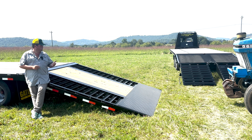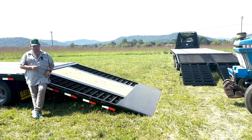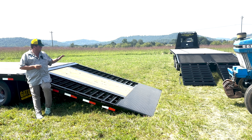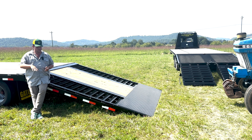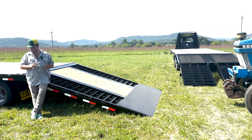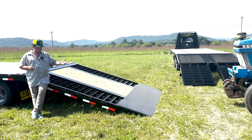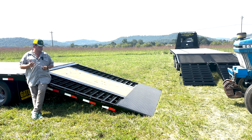Thank you for watching this video. We've shown you side by side what it's like to load on these two trailers. I load on these things all the time, and as much as I have, I still can't perfectly articulate how much more comfortable it is to load on a hydraulic dovetail. You don't have that little spot where you have to pop over the ramps onto the dovetail, that different break-over point. If you're using a smaller truck, you have more worries about lifting — you have none of that with the hydraulic dovetail. No surge as the weight pushes on it — it's 100% smooth, just like driving up a hill. You don't even notice you're going onto a trailer. You get all the other benefits basically for free: lift capability, drive on straight, spare tire capability. It's a small investment for a ton of safety.